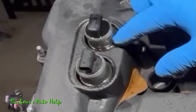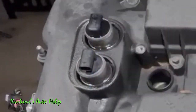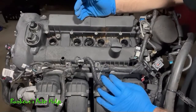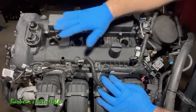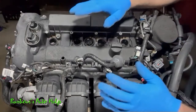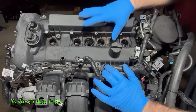One thing I want to bring your attention to — you can see it's lubricated around these VCT solenoids. I added a little oil to those seals prior to starting this video. You may want to do the same with a bit of motor oil to help in removing the valve cover. Also, before removing anything, you should have used shop air to blow off any dirt and grime. Make sure your throttle body, dipstick, and coils are covered up so you don't get any dirt falling into the cylinder head when you take the valve cover off.